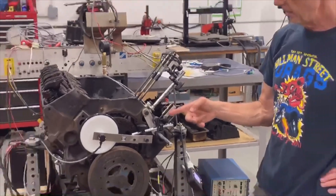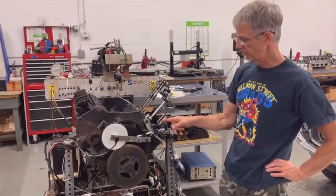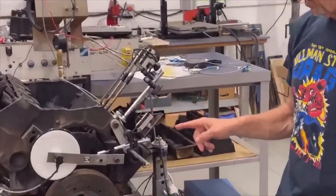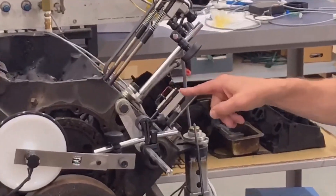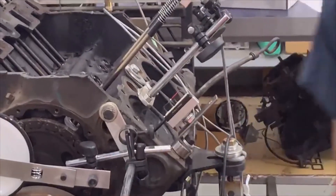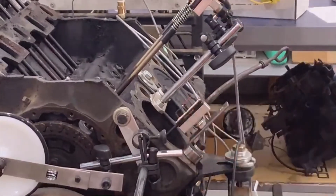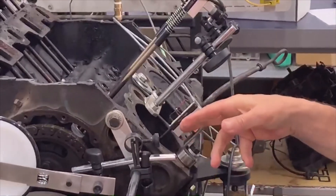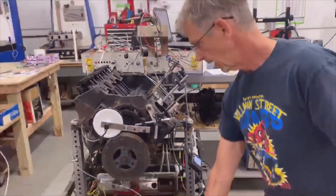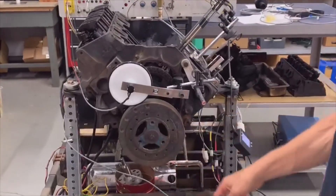When you do it on a stand, you don't have cylinder pressure. So what we do is use another lift sensor — a third lift sensor — which is another accessory you have to get from us, and this will be for measuring TDC location. What typically works the best — you can see we're close to TDC here — is to measure about three-quarters of an inch to half inch of piston travel at the top of TDC. That works out real well. And then over here we're measuring our crank position.